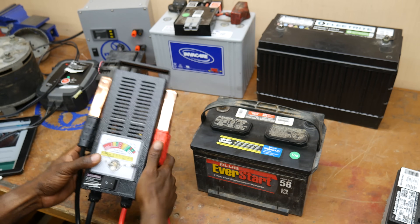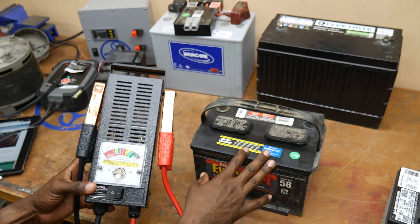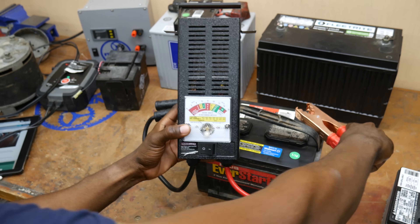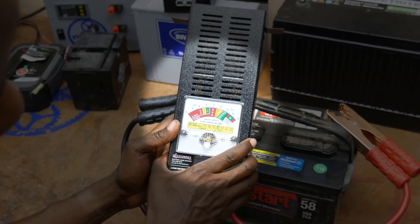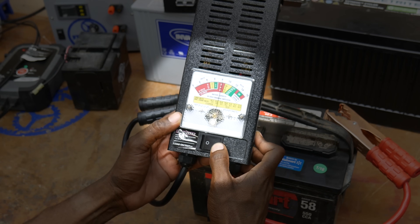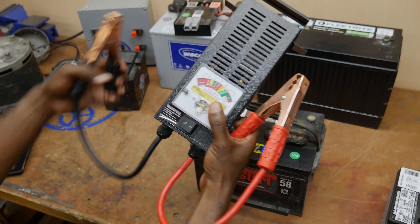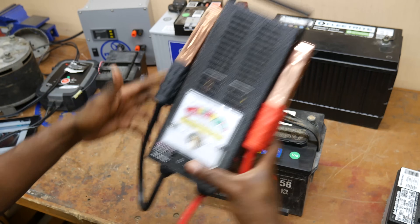This right here is a battery tester. It will test the battery under load, putting a sizable load on it — in this case, drawing 100 amps. I'll put the terminals on. As you can see, it's reading up pretty close to the 13-volt mark. But if I try to draw a load, it goes all the way over to bad battery. So you can see the battery is actually dead — no good. These testers don't cost very much, and it's really good to have one on hand if you want a more accurate way to measure whether your battery is good or not.